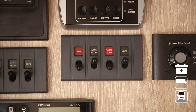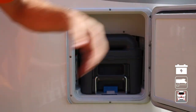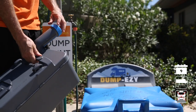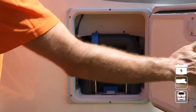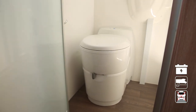The toilet uses water from the fresh water tank and the 12-volt system to flush. Turn on the toilet and water pump switches before using the toilet, open the toilet lever, press the button to flush, and once finished close the lever. The waste is collected in a cassette — the toilet lever must be shut before the cassette can be pulled out. When emptying, use a registered dump station: unscrew the cap, empty the cassette, and use the hose to flush it out. Return it to its compartment and add one toilet chemical with one cup of water to charge the cassette. On returning your holiday, leave the toilet cassette clean and completely empty.